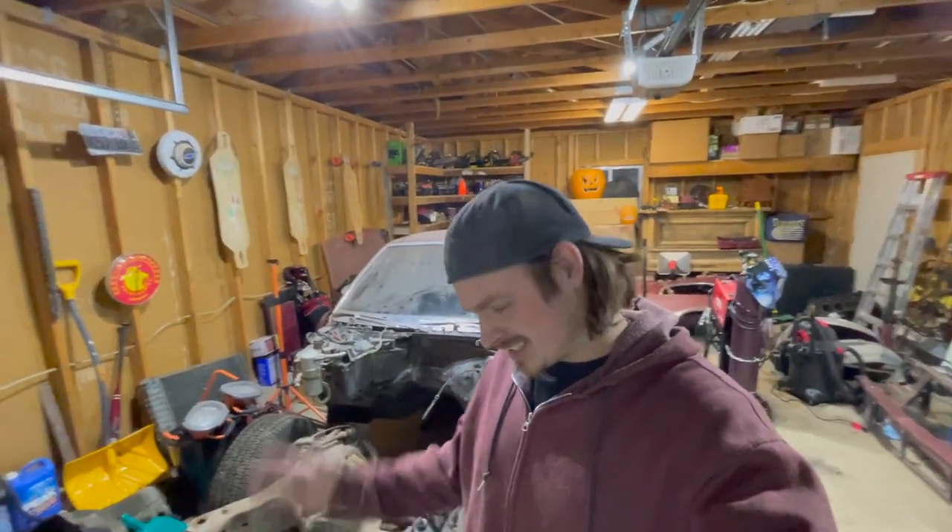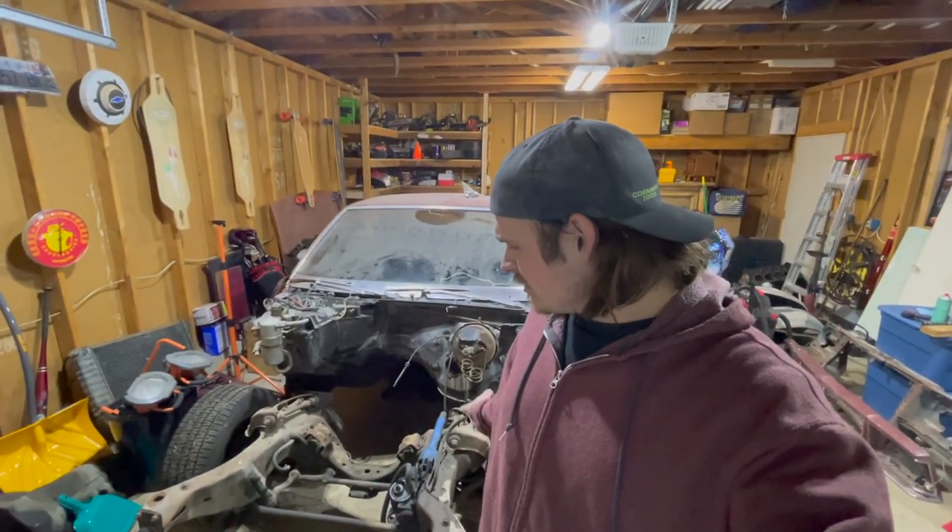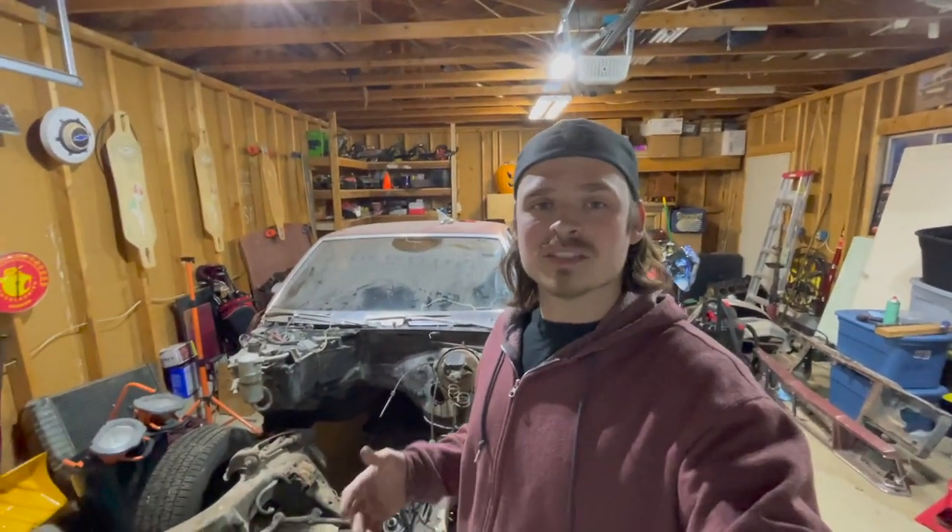What's up everybody, so glad you're here back with me in the garage. I hope everybody's been having a good week and getting out in the garage working on your personal project. Today I'm working on my personal project - I'm going to start pulling more stuff off the car. I'm going to pull off all the steering and suspension components off the chassis, take pretty much all the small parts, sandblast all of them and spray an epoxy primer - a black epoxy primer that has UV protection in it.